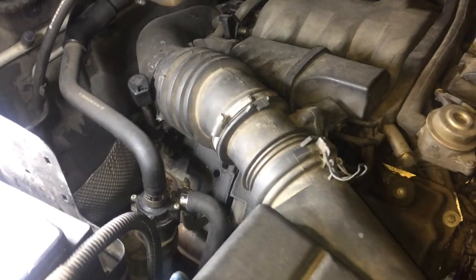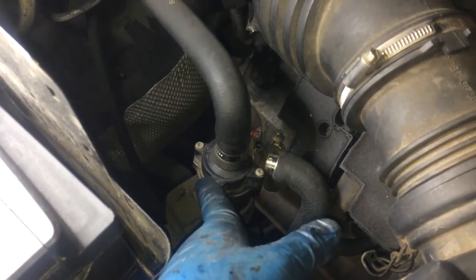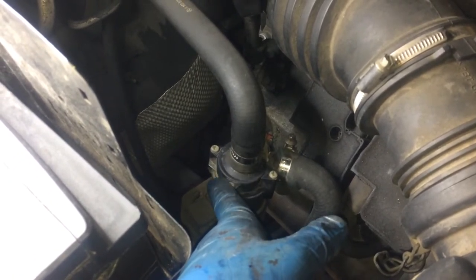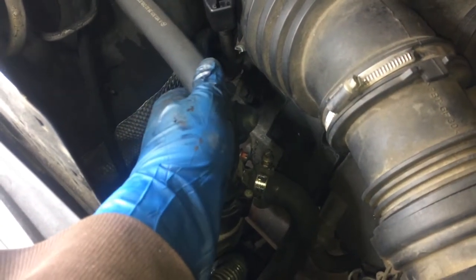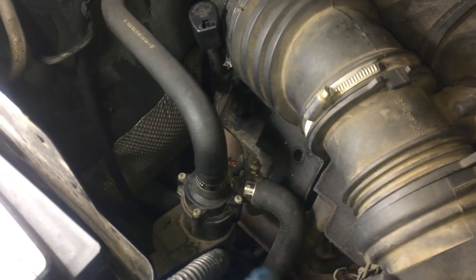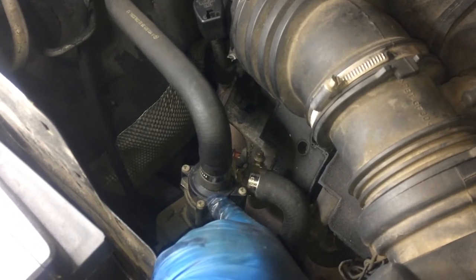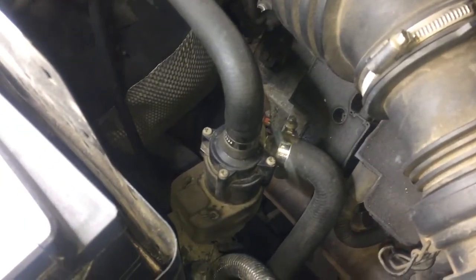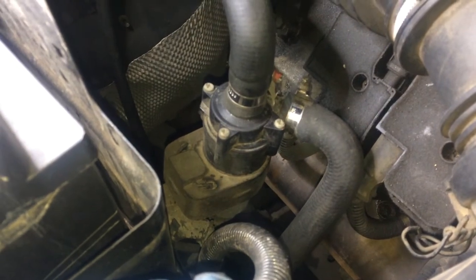The first thing is just to take note of where the water pump is. You'll know yours is broken if there's no noise coming from it after the car has been shut off. Also, when you hold the tube you should be able to feel coolant moving through it after the car has been shut off. You can put a stethoscope on it and listen, and if you don't hear anything then it's probably not working. These go out quite a bit, so it's not really worth pulling them from junkyard vehicles because they're usually seized.